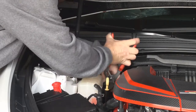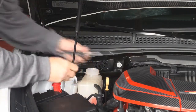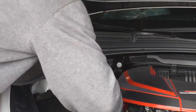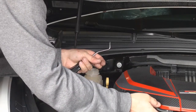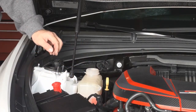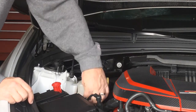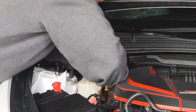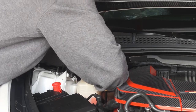I'm going to loosen this clamp and slide it back. I'm going to use a little pry bar — you could probably pull the hose off by hand too, they're not on very tight. See how easy that hose came right off. Just keep it above the radiator line. The back one might have a little bit of a drip when you pull it out. I did drain approximately a pint of fluid out of here — there's not a lot of fluid in this tank. If you drain a little bit of fluid first, you really shouldn't lose any at all.